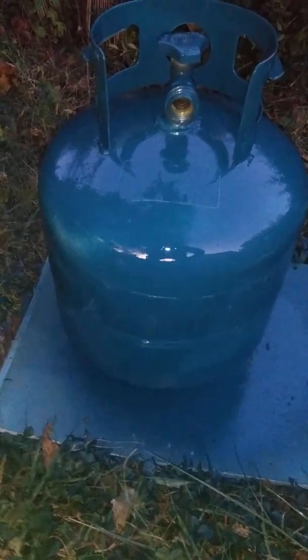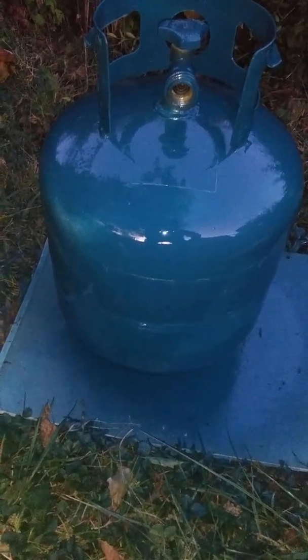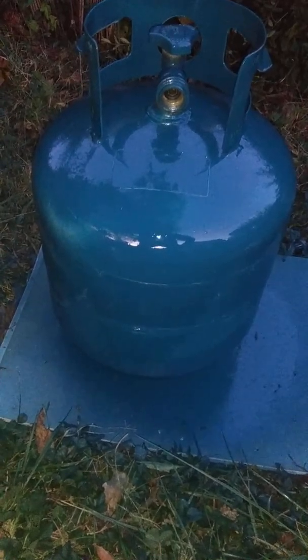Make sure you let the coats dry in between. And then if you have a run on it, what you technically want to do is wait until it completely dries and then sand it down. If you try to sand it too early when it's wet, all you'll do is just roll the paint.